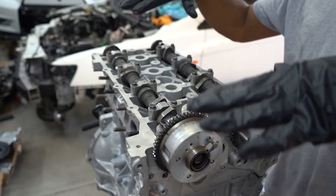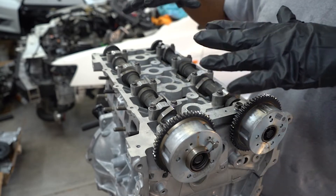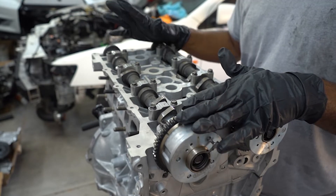Just having the head on has me super excited, it's starting to look like a full engine now and it's getting closer. I still have to remove these cams and cam caps so I can get the head actually torqued down. I'm getting super excited so let's get to work. Next I'm going to remove the cam caps and the cams so I can get the other washers and nuts down to properly torque the head. I have to look up the torque specs using those ARP bolts.